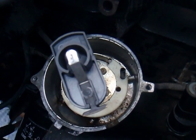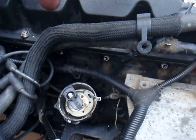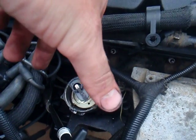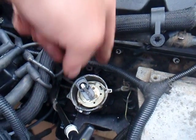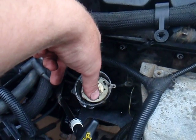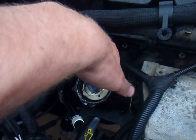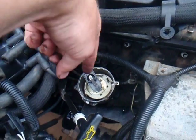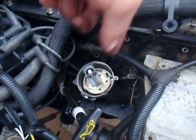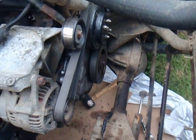That's for the 4-cylinder on a '95. And that would explain why if someone had the wrong distributor shaft in there and they installed it and it wouldn't go past it — you have to pull out the pin and let this pulse ring rotate further than it's supposed to, in order to bring the clamp notch back enough to clamp it down, which would put your timing off by a few degrees. So then whoever set it in compensated by setting the timing incorrectly on the timing gears — sort of custom timing for their incorrectly set-up distributor. That's my theory.